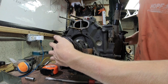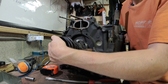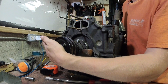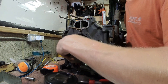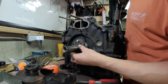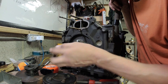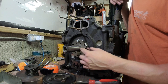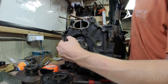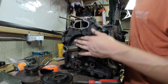Now you'll see there is little to no end play once it's assembled. When you take it back off, you get all your end play back. The reason a thicker spacer gives you more end play is because it creates more of a gap between the front assembly being tightened down — a bigger gap for the shaft to wiggle back and forth. A smaller spacer slides everything further down the eccentric shaft, making your end play less.